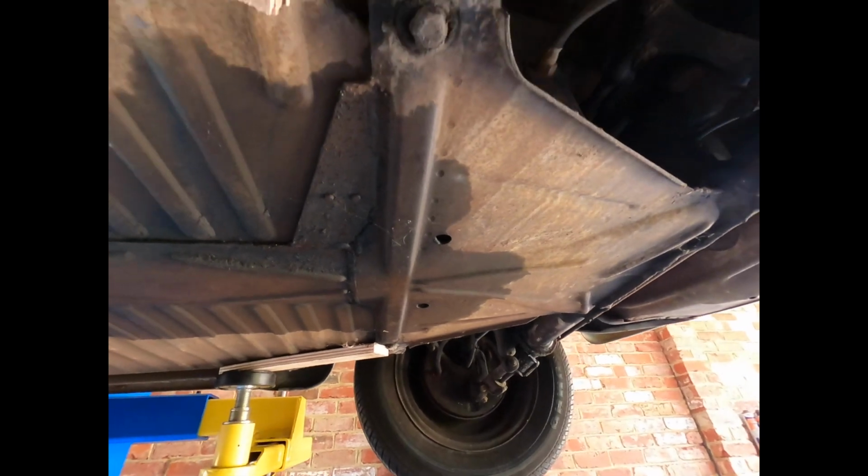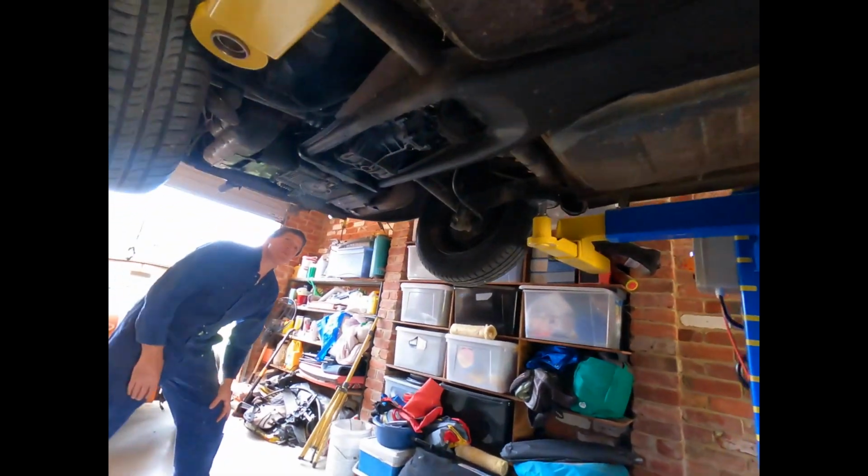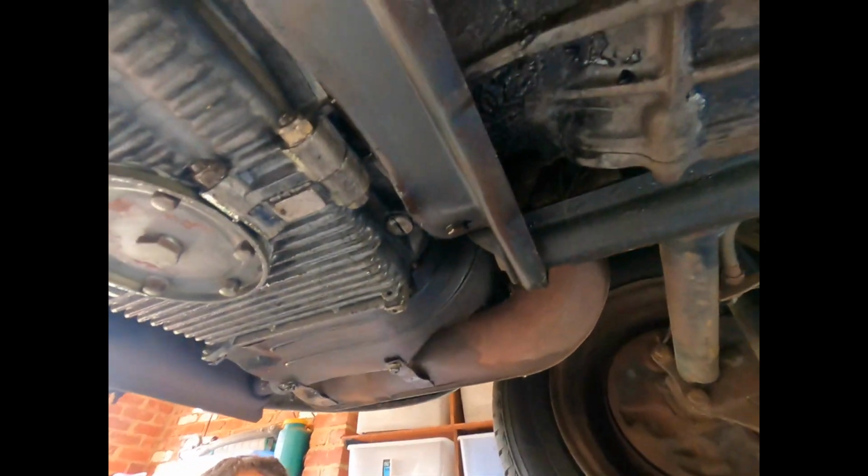We've got a bit of a leak here. That's probably either brake fluid or fuel. It doesn't smell like it. Link pins at the front are worn out. We've double checked. Engine's got some oil leaks. That's an easy fix. Probably a main seal or just weeping past the pushrod seals. I'll take the heads off and clean the valves and change them anyway. I reckon it's well worth bringing the motor down, have a quick strip down, have a look at the barrels.